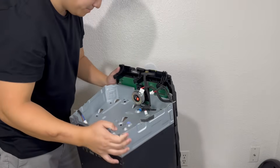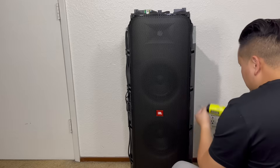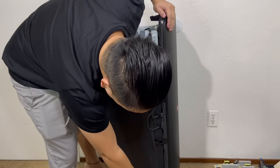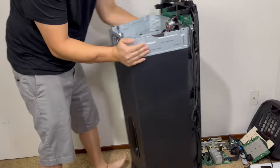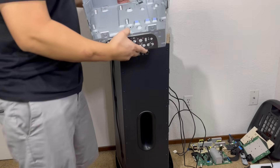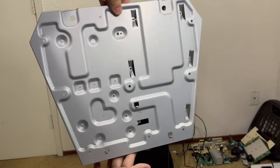Next, we can go ahead and remove the screws from the front grill, as well as detach these cables from the clip on the front grill. We will need to remove the holding tray by taking off 11 screws. This tray serves a dual purpose of securely housing both the motherboard and power board, while functioning as a heat sink, effectively dissipating heat generated during use.